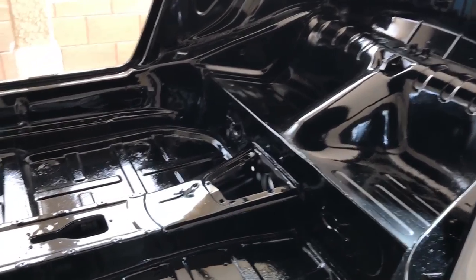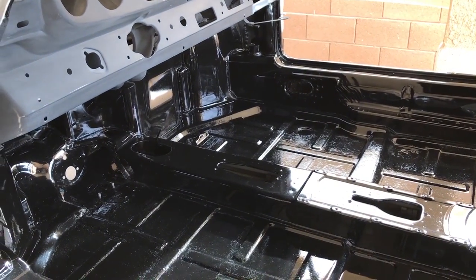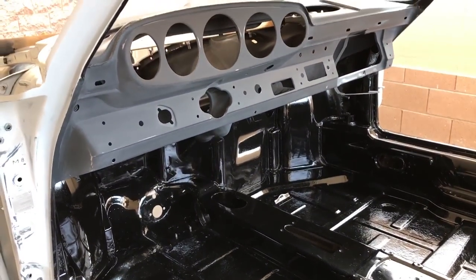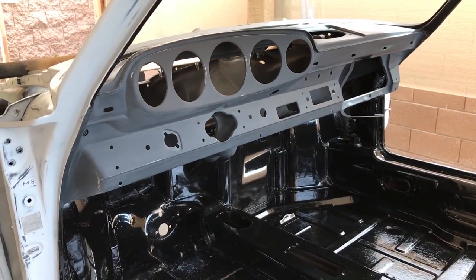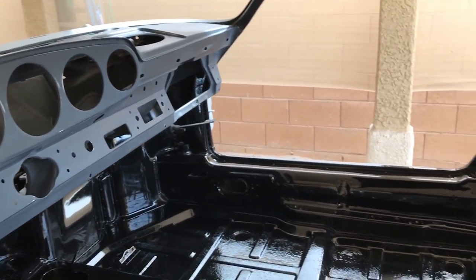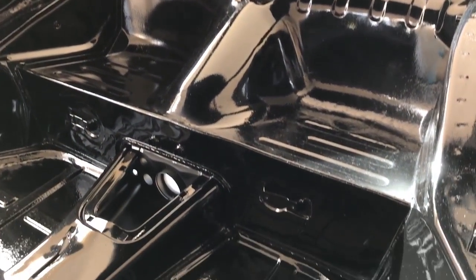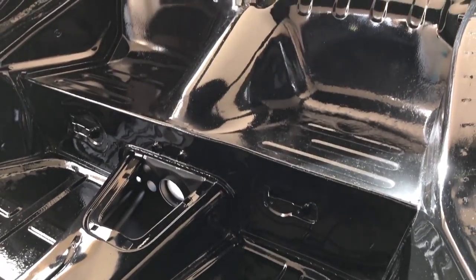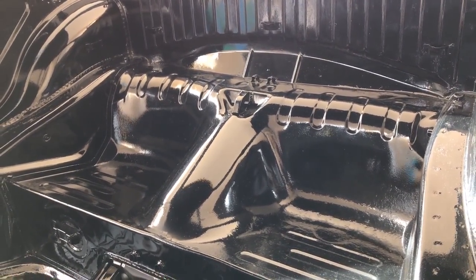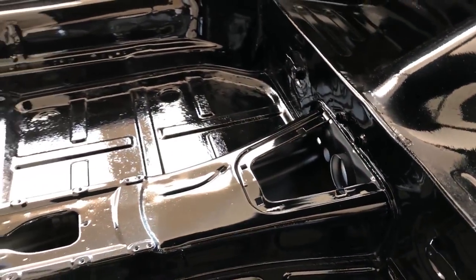This car has a lot of area that has to be coated with something, and there are various things you can use. We'll take a look at some different samples, and I've got some sample boards made up of different textures and products to do a textured undercoat. Our interior is basically POR15 right after sandblasting — did this earlier in the year, last year, and then we recently caught this up near the back.